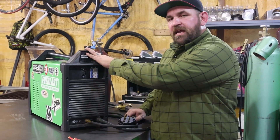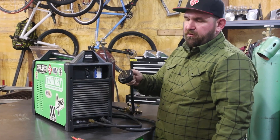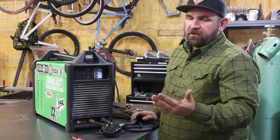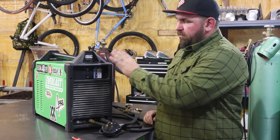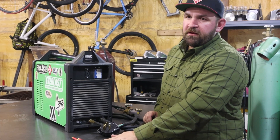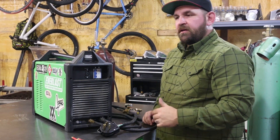Now that we're taking the back panel off and pulling the case off the machine, you always want to make sure your machine is unplugged before getting inside it. I've had mine unplugged for about the last 30 to 45 minutes, so it's more than safe. But please remember: whenever you pull the case, always unplug your machine, let it sit for 20 to 25 minutes, and let those capacitors de-charge.